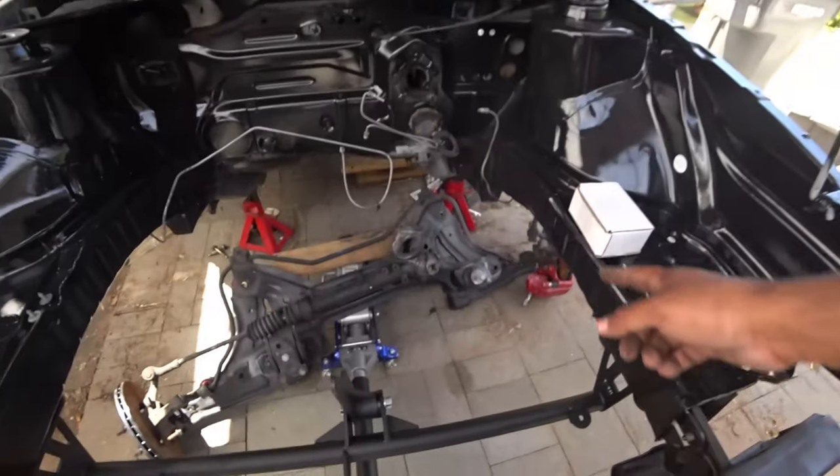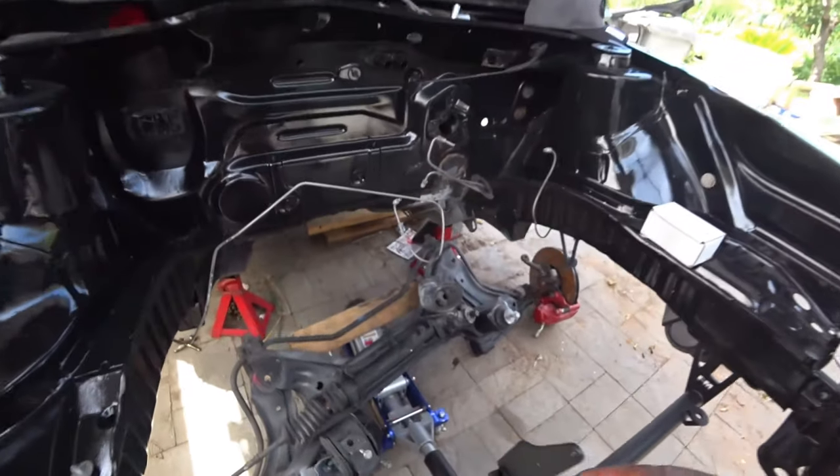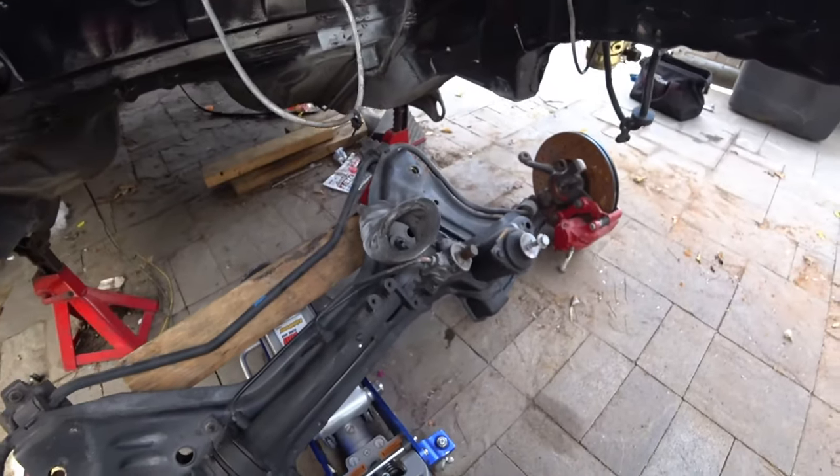So how do you get the manual extender? I went on eBay and used the part number — I will post it in the description. Take that bolt off, take the other bolt off, pull the rack down. Another part you're going to need is a second steering rack bracket, because the manual rack uses two of them versus one due to the different style rack. That's pretty much it. We'll show you how to put it all back in.